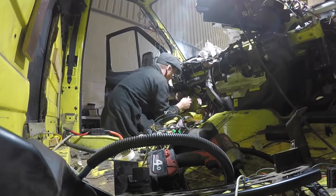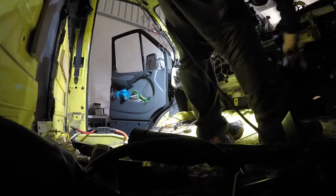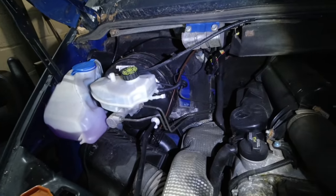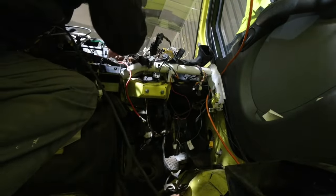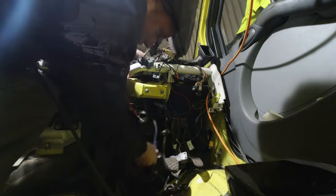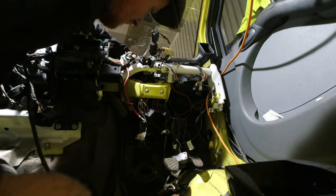And in goes the new brain — something I never thought I'd say. This really is Frankenstein's monster isn't it? The donor van's now gone so I've got no point of reference. But I've got Emma's van just over there, so any time I'm like 'where does that go, where does the clutch cable go?' I can just pop the bonnet on hers and see what's what. It was only around where the steering column goes that I really struggled — that's where all your controls are, they had to tuck round and clip onto areas so they wouldn't get caught and still reach the steering rack when it goes back in. I kept having to bring in the fuse box, instrument cluster, and even the steering rack just to suss out where all these plugs have to sit, ready for reconnecting.